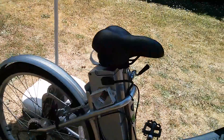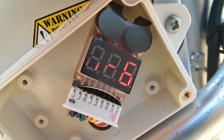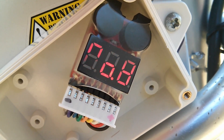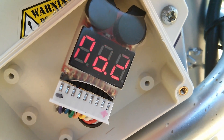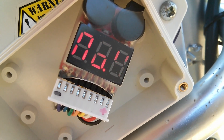So let's have another look at this voltage monitor, which is measuring all the cell voltages: 333, 328 — some of them are just alarmingly different to others — 332, 330, total 26.4. So I'm going to measure this with the DVM to see whether it's just this little cheap monitor unit that's wrong.